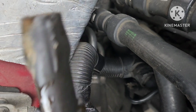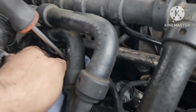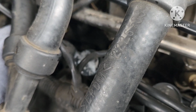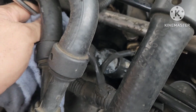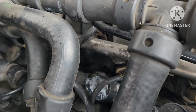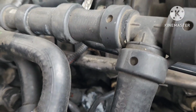Your coil. Make sure there isn't any water or oil like this, so there could be a little bit more going on. So the bad thing about these coils is the recess down in there, so when somebody's doing an oil change, like here, you might spill some oil and it tracks on back, and I think that's what happened, because these don't necessarily go through an oil passage like they do on some other cars, like through the valve cover and stuff. So I've sprayed some cleaner in here and I'm just sucking it out. And we're gonna see what I can do.